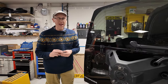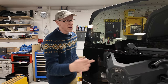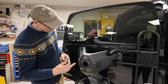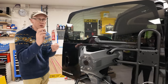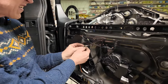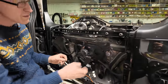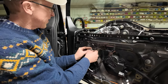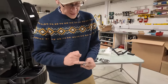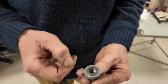They only give you three M10 spring washers, which are anti-loss, anti-vibration. You don't need one on this one here, because we've got a nylock on the inside. So they're reserved for the other three, the top one and the bottom two. Washer is going to go on here, but it's not spreading the load a lot there, is it? Considering the size of that hole and the size of the washer on the original one and the weight on there, I'm not sure that's big enough. Right, so this is the nut with its integral washer that I took out, and that is the washer they give you.